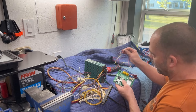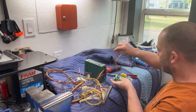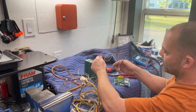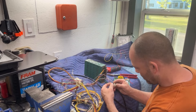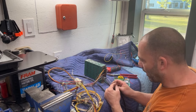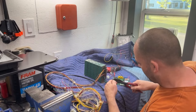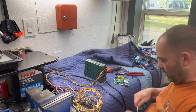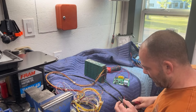Now we need to plug the power into the converter board. Then we have to take our signal wires from the monitor, which have already been spliced together. I'm trying to see how they did this — I'm guessing red, green, blue. I think what I'm going to do is cut these off right here and use the cable that comes with one of the converter boards.